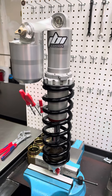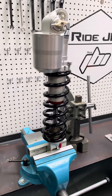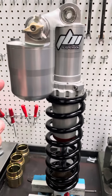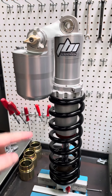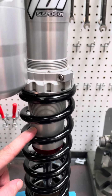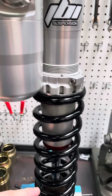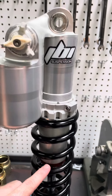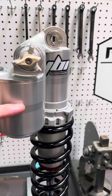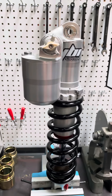And the coming 2023 models have a new shock absorber, new frame, and new swing arm. The most noticeable thing you can see is that the free piston is much bigger than it ever has been. What that means is this shock shaft goes inside this shock body and it pushes this free piston down. It has a lot less movement to do that to accommodate the volume of the shock shaft. Why is that important? Because as this piston moves, there's some friction and stiction along with its sealing — the more we can reduce that, the better this system works overall.